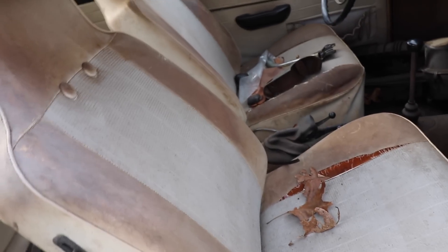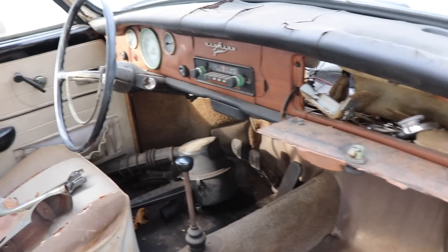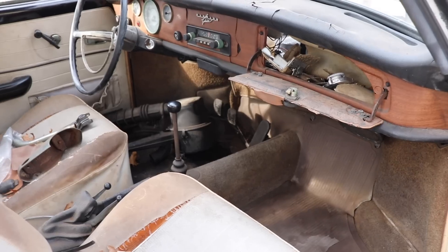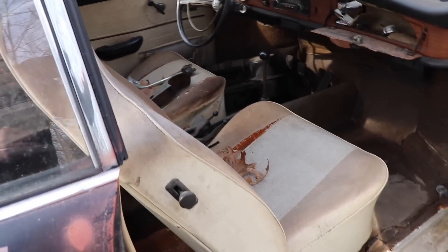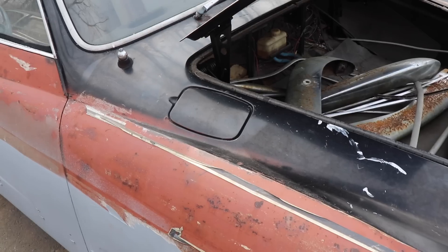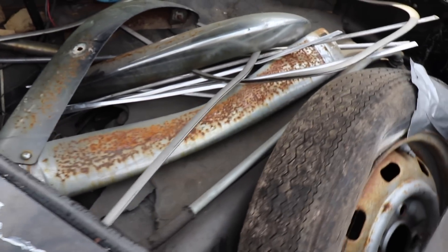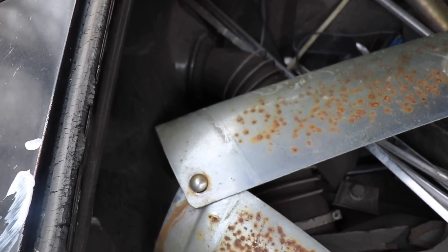The interior is really crispy - I mean like baked, like it was sitting in the Florida or Arizona sun or something. He said it was in his shop, but it's just so dry. But it's all there. 67 was the first year of the wood grain. The key on the steering column first appeared in the 68, and I believe the 68s had one-year-only seats. 68 was also the first year they went to the gas cap on the outside on the fender - 67 had it under the hood, which I prefer if you're getting gas fumes in the car on a full tank. You need to replace that hose.